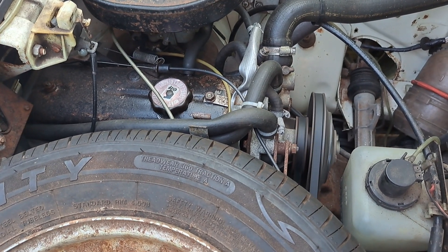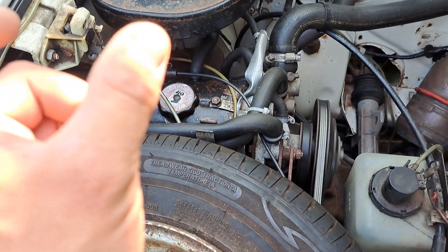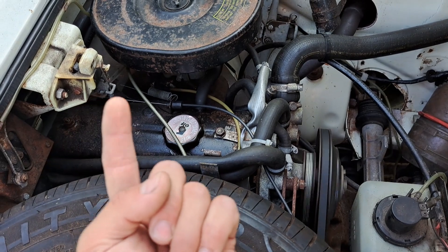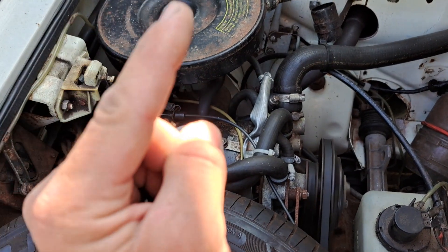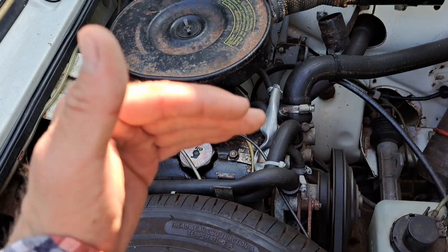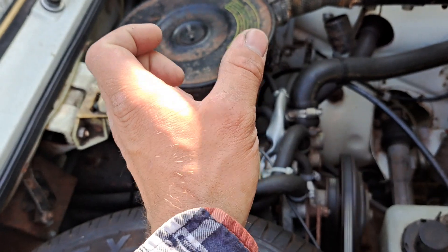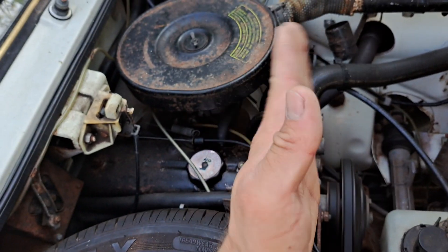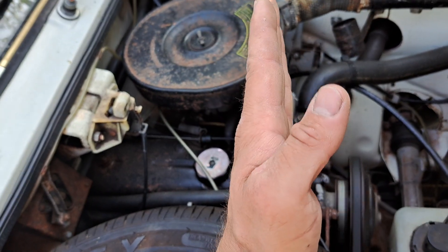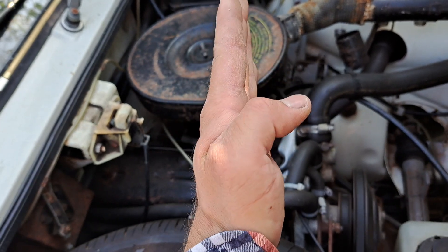The engine got really, really hot, and it can also suffer piston ring damage where the rings essentially slightly melt. You've got your ring that's basically round, but it's actually square on the top and bottom edges, and that's what helps keep the pistons going straight. But when they wear out, you get the pistons slacking around backwards and forwards. When it gets really, really hot, you can actually end up where the piston rings get damaged, which gives it the same effect as being worn.